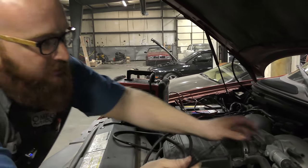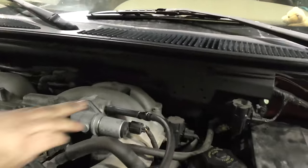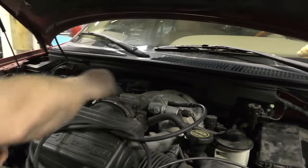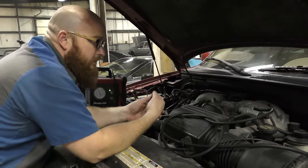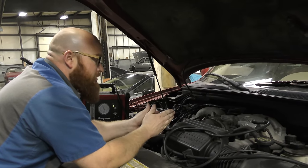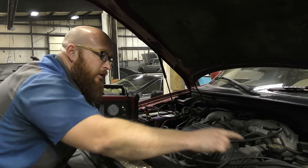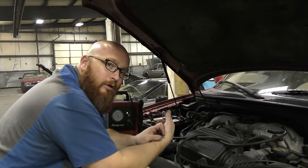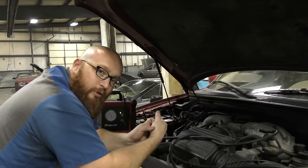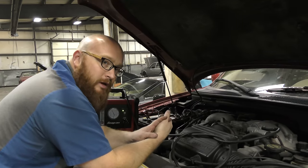These have a pointed tip that fits just about any piece of hose or whatever, and it stays there. It's a little wet from the oil vapor that's been collecting on it. But now we've got that hooked in, it's going to pump the intake full of smoke, just like it did the EVAP system. If there's any leaks or broken vacuum lines, you're going to start seeing wisps of smoke. It is going to have smoke come out your air filter area — that's normal. Don't be alarmed.